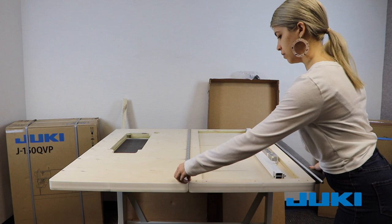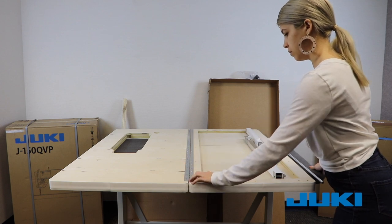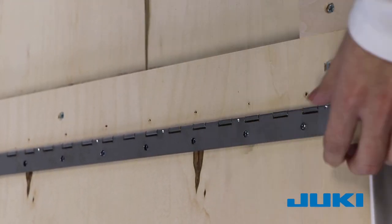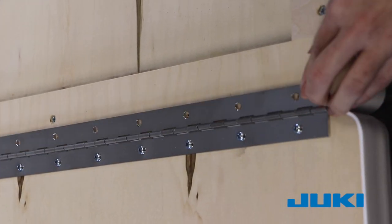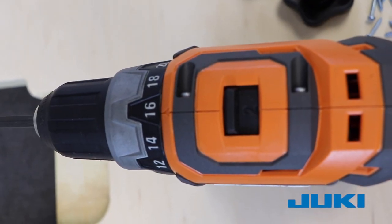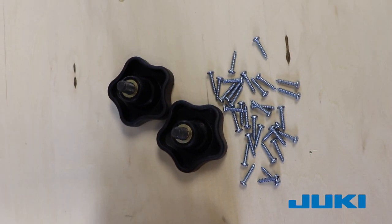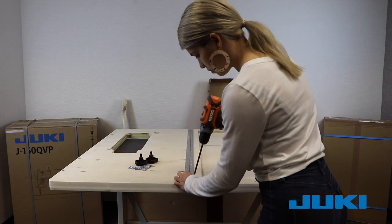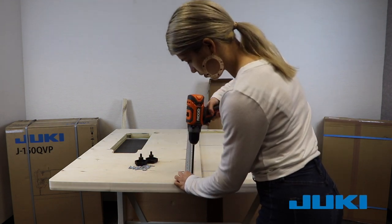Secure the piano hinge connecting the top surface and the extension leaf, flipping over the half and unattached half of the piano hinge. Hand align it with the pre-drilled screw holes in the extension leaf. You need a Phillips screwdriver, a power screwdriver, or a controllable drill with Phillips driver bit. Start at one end and begin screwing in the screws. Take your time and do not rush.